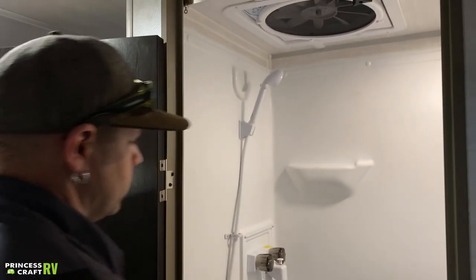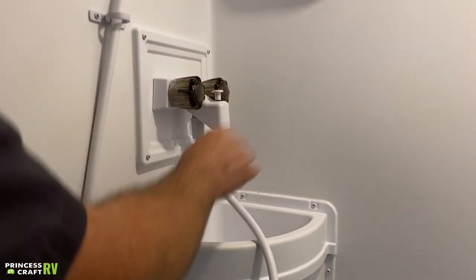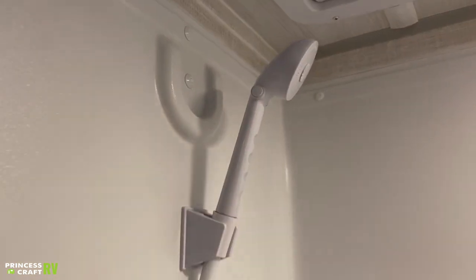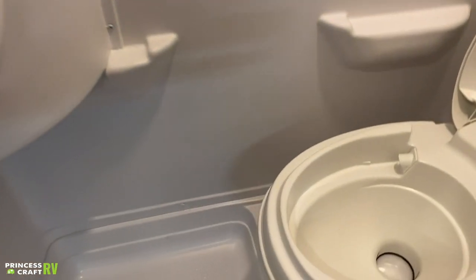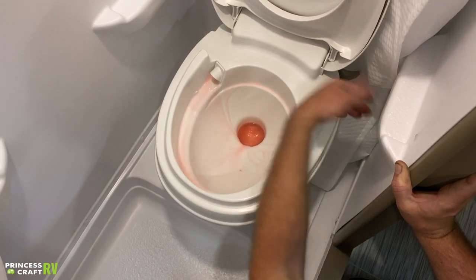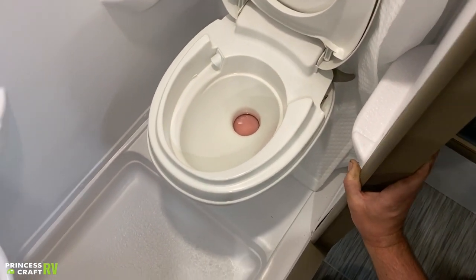For your shower, you have hot and cold mixing and a diverter for the shower head. Put water into the little sink, or pull up the diverter to run it up to the shower head — which has a flow control lever; one way allows water to flow, the other drops it to a trickle to conserve your roughly six gallons of hot water. The toilet is hand flush: halfway puts water into the bowl, and pulling it all the way opens the blade valve, sending everything down into the black tank. Remember to use toilet treatment to control waste digestion and odors.